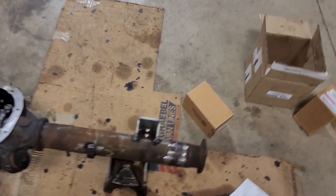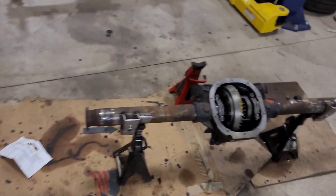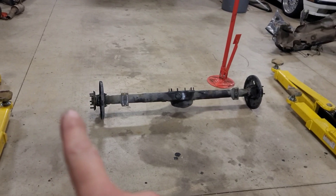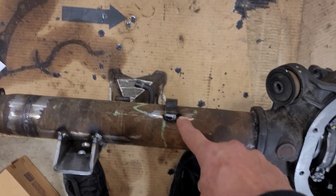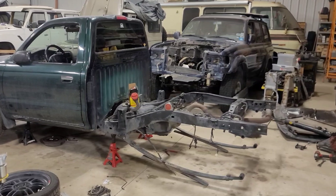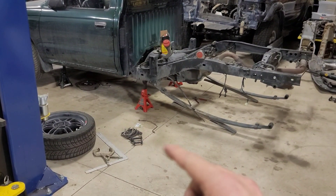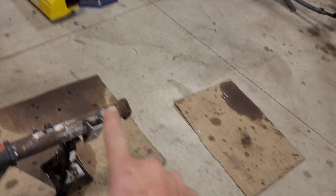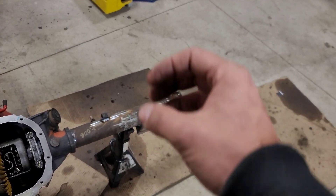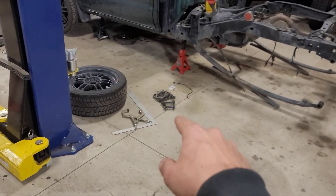The leaf spring mounts are from Trail Gear — they'll raise the axle about a half inch compared to factory. There's a part number right there and they fit the axle tube perfectly. You could cut the mounts off your old axle and use those, but these are a little longer so they might help with axle wrap. I cut all the tabs off the factory axle for the brake lines and I'm reusing those. The factory U-bolts are slightly too short with these leaf spring perches because they raise the axle about a half inch, so you lose half an inch of thread — I still need to replace those.